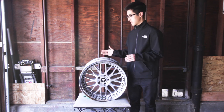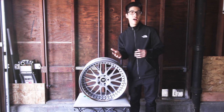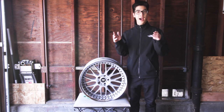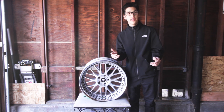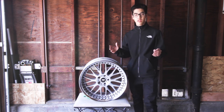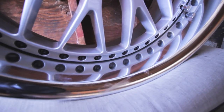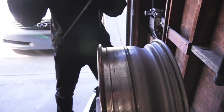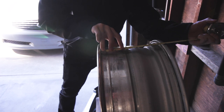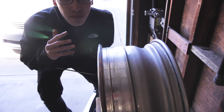When dealing with fitment, this plays a large part in picking your wheel size and seeing how the wheel would fit on your actual car. I didn't know this beforehand and it cost me quite a lot of money. What I'm going to be doing with these wheels is relipping them. Measuring the lip is pretty similar to measuring the width — you start at the bead and end at the middle of where the silicone ends, which is about three and a half inches. So my lip is three and a half inches right now.